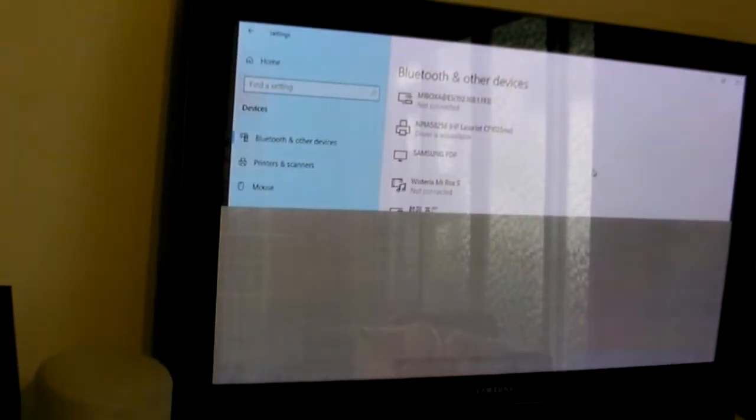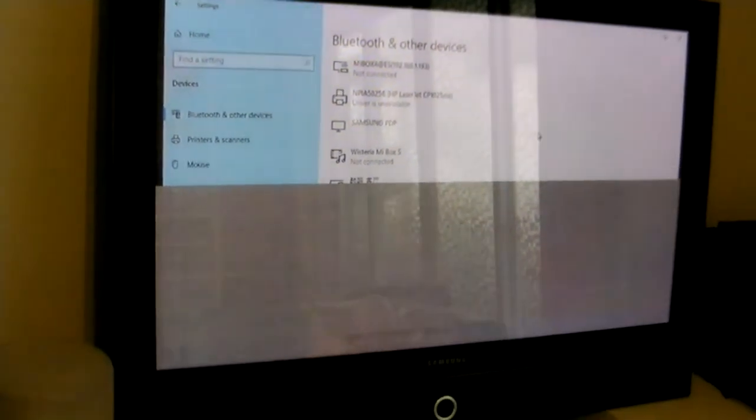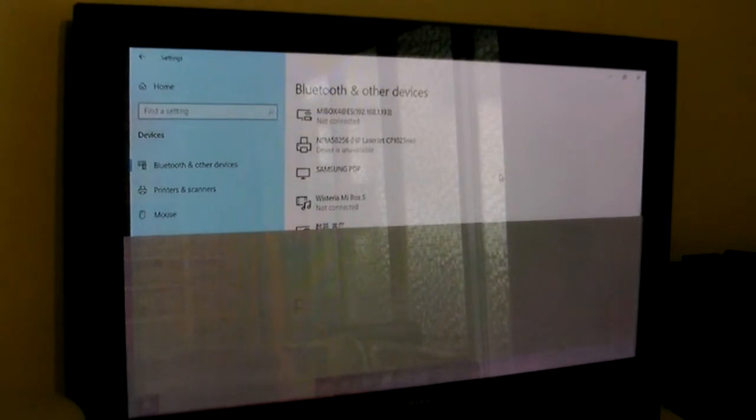So when it's a bit gray, I can read it and use the computer and the screen, but when it's like this, I can't. So I just give it a few taps, and hopefully the neighbors won't start banging on the walls, and it will come back. So that's the sort of first blush troubleshooting of this panel, is that it seems to have a bad physical connection or solder connection inside, and as things heat up from the panel being in use, things move around.